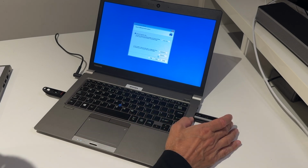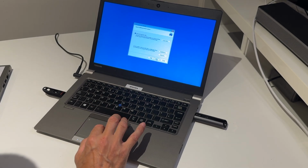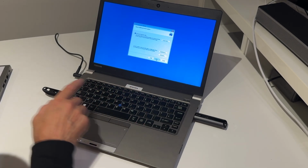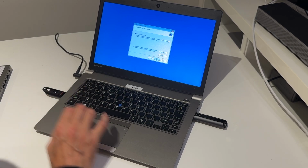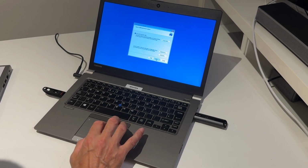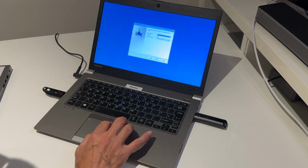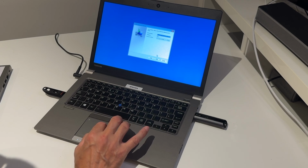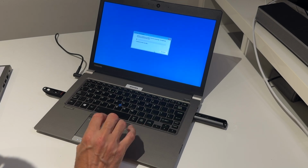And this key was made on this system, so all the drivers should be here. Actually, the drivers are on here, but Windows 11 24H has got a lot of drivers on there. And this is again a six or seven year old laptop. So next. Your computer will be restored from the following system image. Finish. All disks will be reformatted. Yes. Preparing to restore your disks.